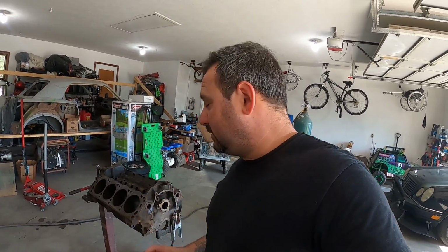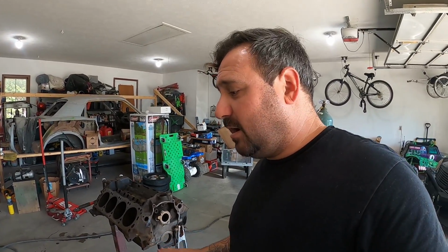And it's a lot of fun. So next time you got a bolt that's broken off, rusted in place, and you got a welder and a little bit of aptitude, you can go ahead and use this for your next extraction trick. It works like a charm. I've used it on aluminum cylinder heads. Works good on steel. It's just a great method to get a broken bolt out.